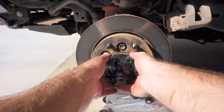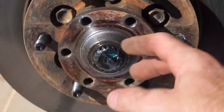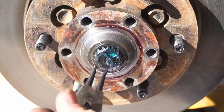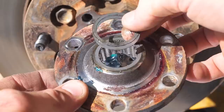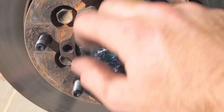Pull the cap off and put it aside. Now with the hub cover off, you can see there's a little circlip in here that holds the end of the hub onto the end of the CV shaft. Pop this circlip off and then we can take that end of the hub off — I'm just using circlip pliers to go into the holes and get it off. There are a few little shims in here, so make sure they stay in the same spot. Now we've got a locking ring on the outside, and behind that a tensioning ring, and then we'll get into the wheel bearings.